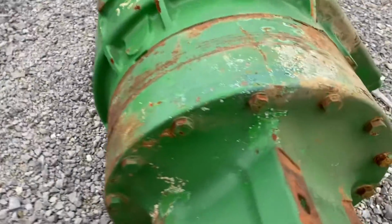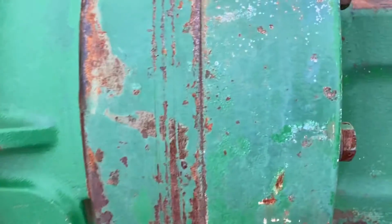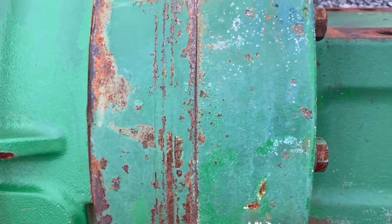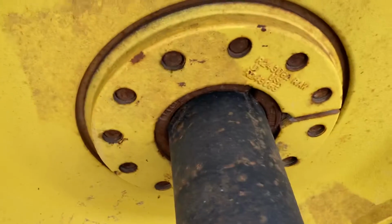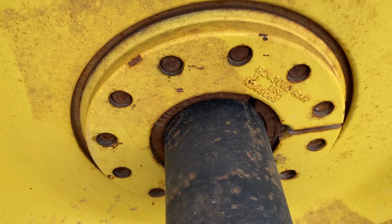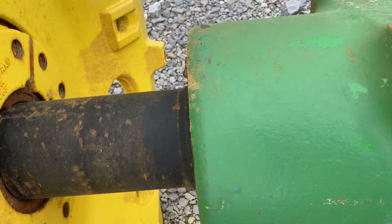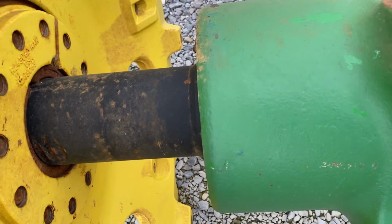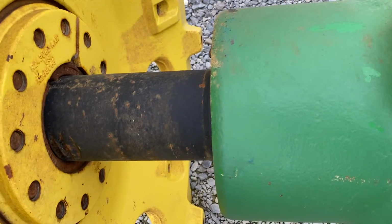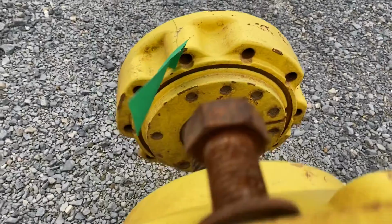14 bolt, this would be like a 90-30 series. Still has the wide casting. You can still get the 10 or the 12 in the double taper. You just have a smaller bearing, smaller axle shaft. So depending on what your application is, if you're breaking axles, you may go to the 120. If you're breaking wedges, you can just go up to the double taper.